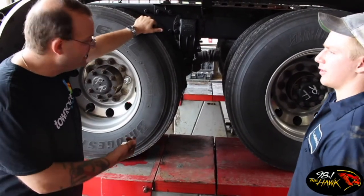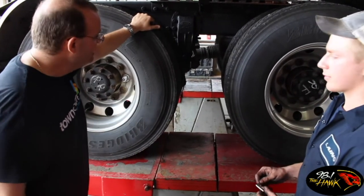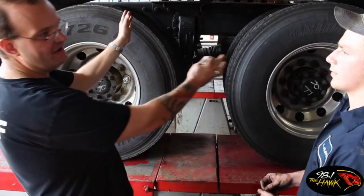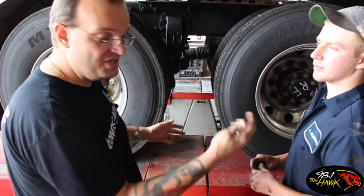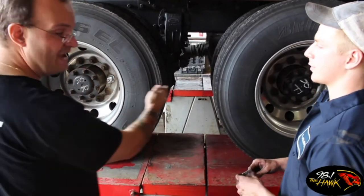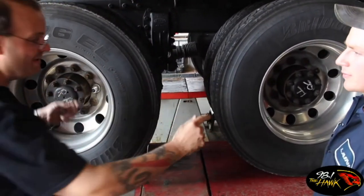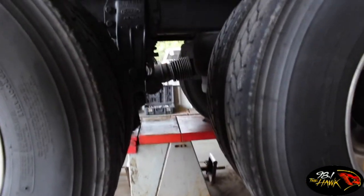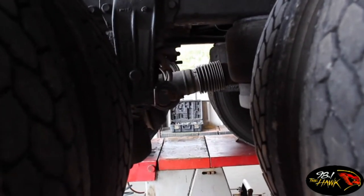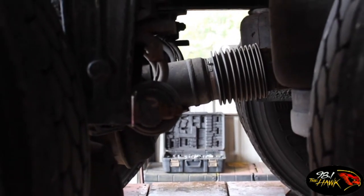We're back in the truck right now because earlier, off camera, this fine gentleman already added shims to the axle. What's happening here is you're trying to figure out where the load's going to be and make this thing handle as best it can, correct? Right. What we're actually trying to do when we put the shims in is move these axles backward or forward. If you zoom up in here you'll see that the shim is moving the entire axle forward — just a little bit, but just that much is enough to make sure that the toe happens correctly.